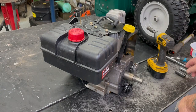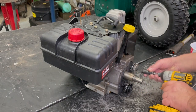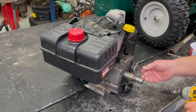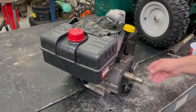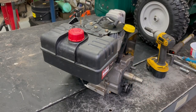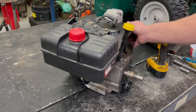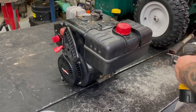That thing is stuck on there. About to spray some lube on that to break it loose. And this here, this runs off the camshaft. That's for like reverse and stuff because this will spin this way and this spins the opposite way. So let me get some lube on that, spray that, let it soak for a little bit. While that's soaking, we'll go ahead and get the gas tank and the shroud off and everything.